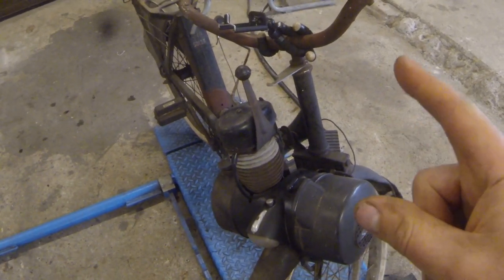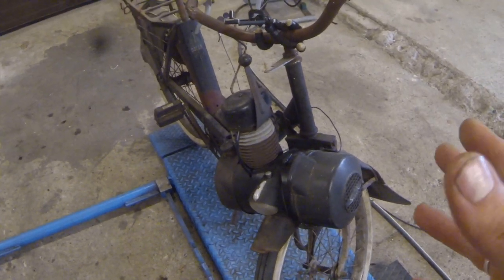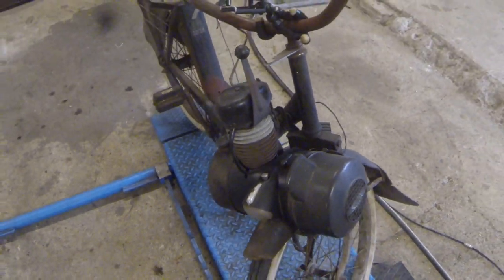What I have been wondering, and have been tempted to do many times but haven't done, and now I've decided to do, is to actually change the barrel on my Velo Solex. I'm going to change it for an aluminum one, which is supposed to have some altered timing for the channels inside the cylinder. I don't know the English word for that, but it should give the Velo Solex a bit more power and a bit more low-end power.